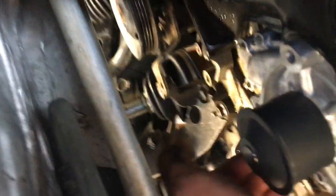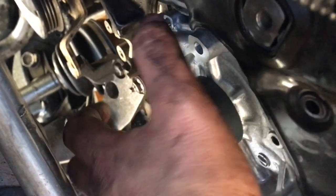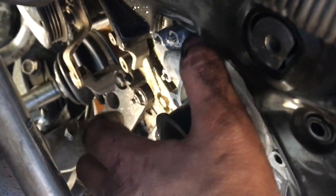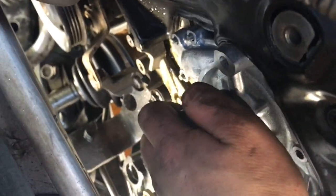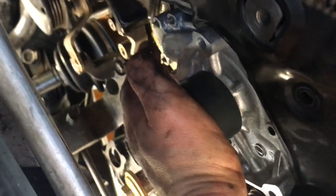Honestly, all the other YouTube channels make it look so simple, but you want to be sure none of this gasket overlaps the cover. Make sure it goes under the cover — there's a little dowel alignment notch here — just be patient, wiggle it in there, you'll figure it out. Don't force it. The same thing goes with the new water pump when you're putting it back in — be patient, remember how you wiggled it out. I was at an angle and just couldn't get it to go in, so I put a little bit of force down to straighten the housing out, and once the housing got straightened out, boom — slid right into place.